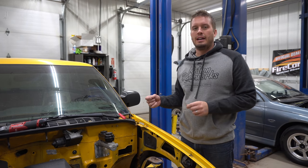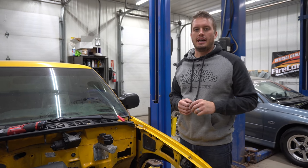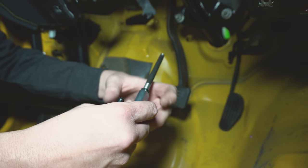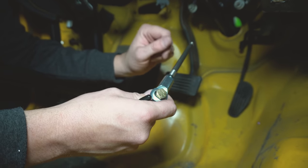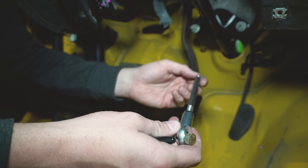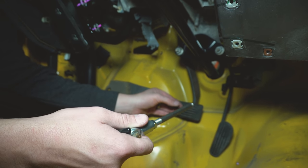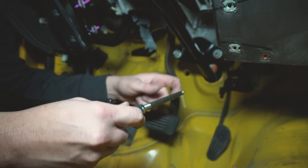We're going to move on to the inside and I'll show you why we had to make a custom pushrod and how to install it. Here we have our custom pushrod that's included in the kit — a rod end and a locking nut. When we're done, we'll tighten that down so the heim joint won't loosen or tighten once it's in position. We're going to mark and then drill where the 3/8" bolt goes through the pedal. The reason we made a custom pushrod is so that the connection lands on a proper spot to create the correct pedal ratio.